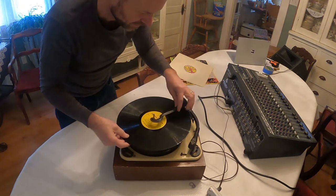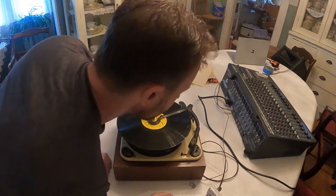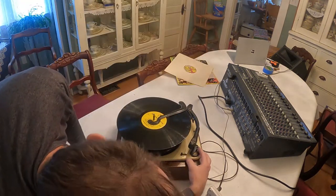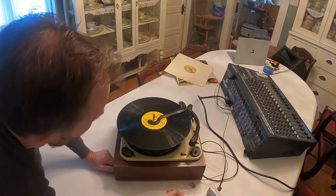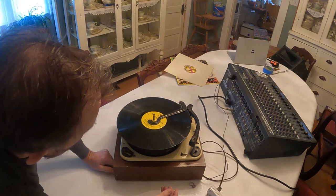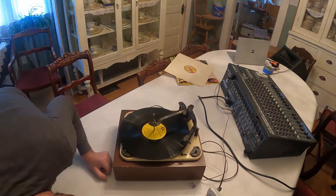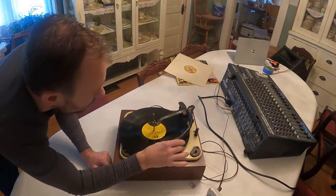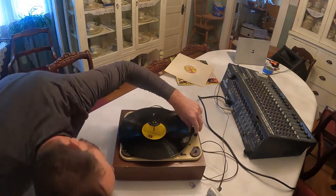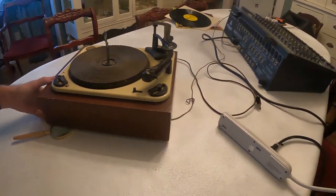You know what, I'm going to go ahead and just try its auto feature. So I'm going to put this here, drop that on it, put that on 33. Let's go ahead and see what happens. The needle should come over and come down — okay, it kind of fell off the record. I'm going to scoot it over. Did you see that slide across? That means our needle is no good. Let's take a look at this needle and see what we have to do here.